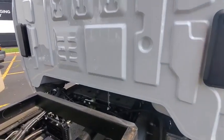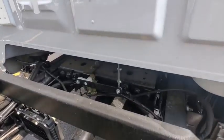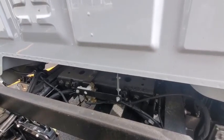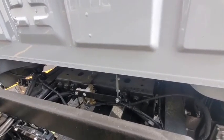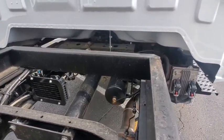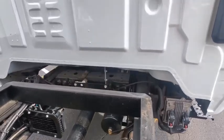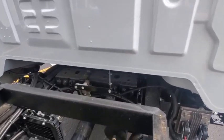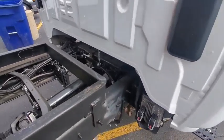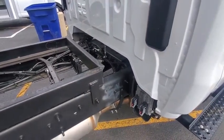There's a ride height control valve in the back that will maintain pressure in the airbags as they deflate, and keep them charged. There's also an air tank below that will recover the airbags as they deflate. The ride height control valve controls the height and keeps pressure throughout the system — low maintenance for the operator.